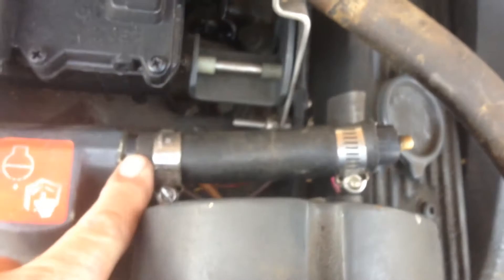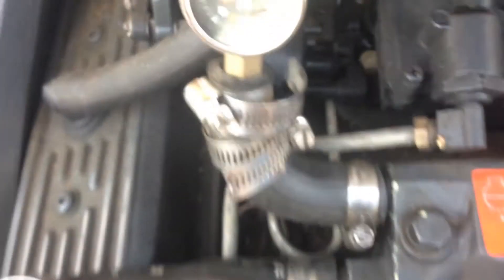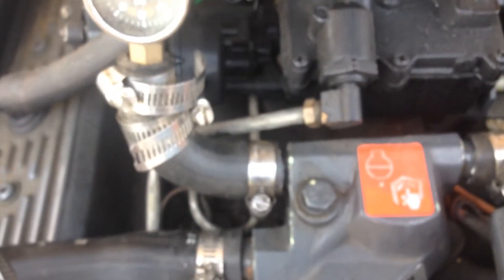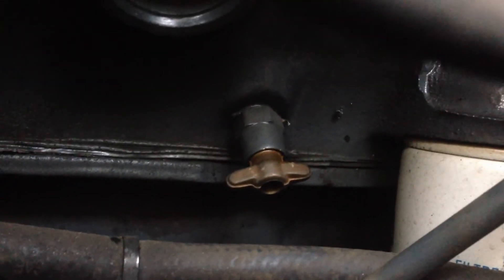What I've done is disconnected the water outlets going to the exhaust on both sides. On one end I put a tire valve stem, and on the other end a pressure gauge — you can see it's still at 8 psi. I pressurized the system after draining the water out of the block. There's a drain plug on each side; you've got to drain those first.